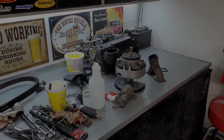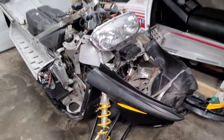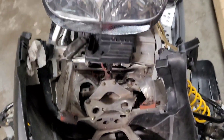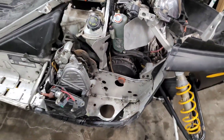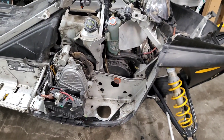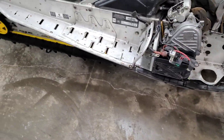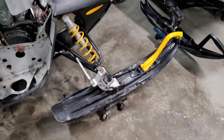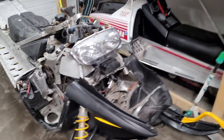I'm calling it a night - I just finally got that starter out of there. What a struggle. When these frames are all twisted up like this it really makes everything pretty tight in there. Next session I need to drain the coolant, disconnect all the electrical, and then rip that motor out of there. I also want to pull the chain case off and get this track and rear skid out, plus the front skis and shocks. After that, basically everything else is junk.